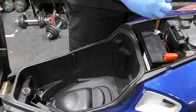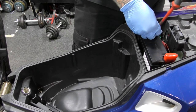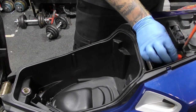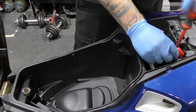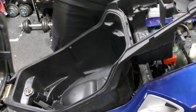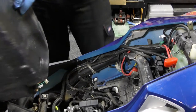I always say in all my videos - take the battery out and charge it. We've got to take the battery out anyway, so why not charge it? Put the actual screws back in the holes they came from, nice and easy to avoid dropping them. Take the positive off - plastic all around here, she's not gonna touch any metal, not sparking at all. When you do lift this out, feed the wires through here. There's just a little plug - give it a pop and pull out, and there's your seat out. Nice and simple.